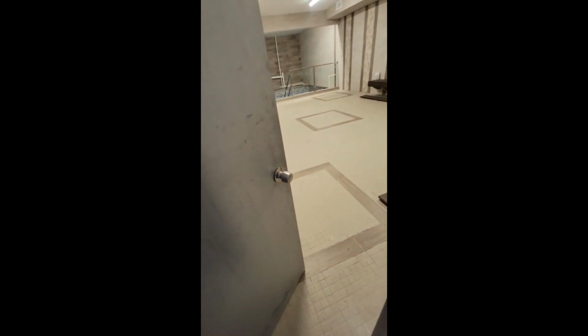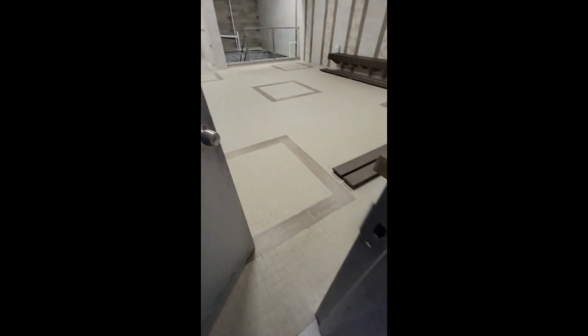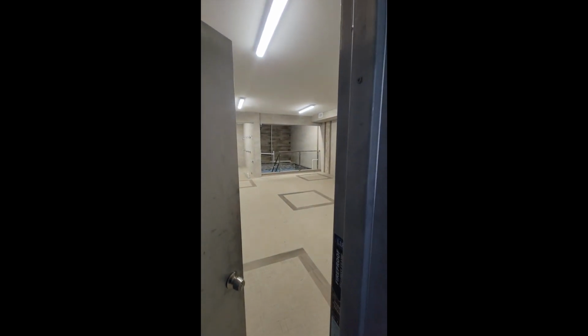All right, so this is the new door that they just installed. It literally has a deadbolt knob on the bottom, but we're going to be putting a knob way up here on the door, because by Department of Health code, you have to have a knob up high so a kid doesn't have access. And it's going to get a buzzer system, because the magnets with the water inside and the humidity just aren't going to hold up indoor or outdoor. It's just too much humidity in here.